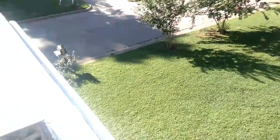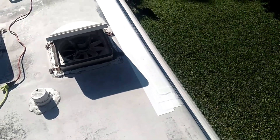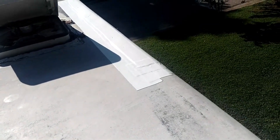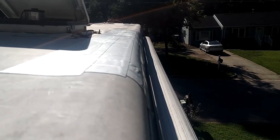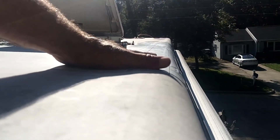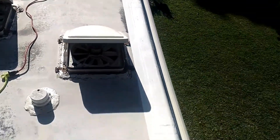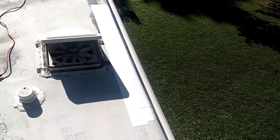Here is my roof repair. The bright white is the seam tape I cut and put over top of the aluminum flashing that I curved to shape. Looking down the length of the camper now it's got a much better look. It still stands out because the tape is thicker and a slightly different color, but I'm about to resurface the entire camper with brand new white roofing rubber that will cover everything. I am thrilled with this compared to what was here before.